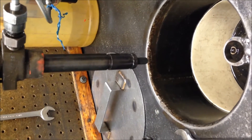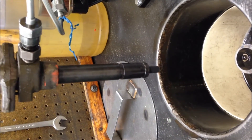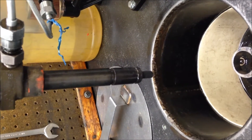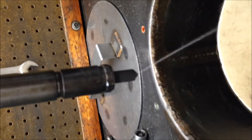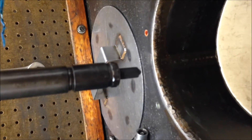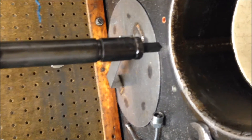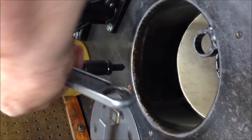Yeah, they're just not doing what they should be doing. The needle valve is sticking in there, I think. Pressures are close, but see the two holes on that one? See that one come off on the side there? The little one just does a little squirt, and the other one does a solid stream. I like your first set better. Yeah, it's not doing right — something's wrong.